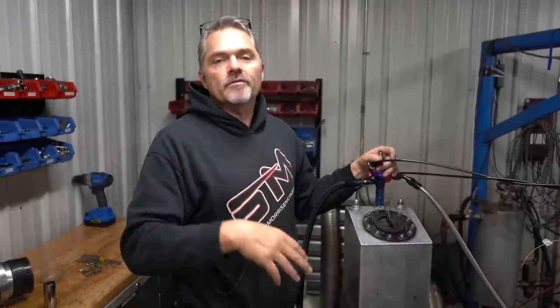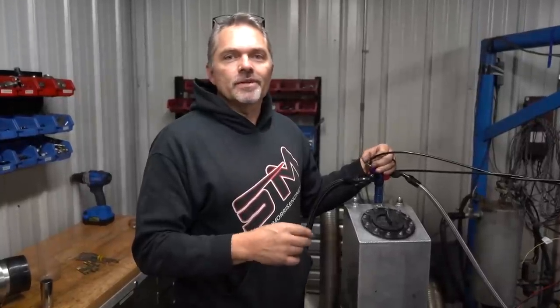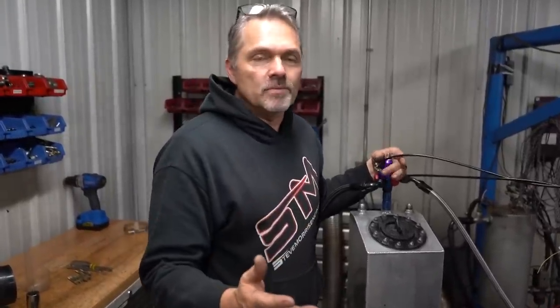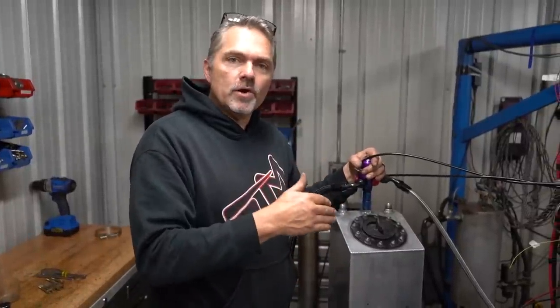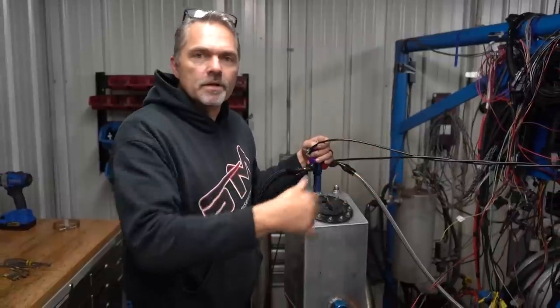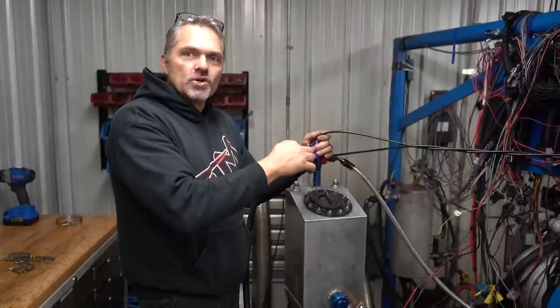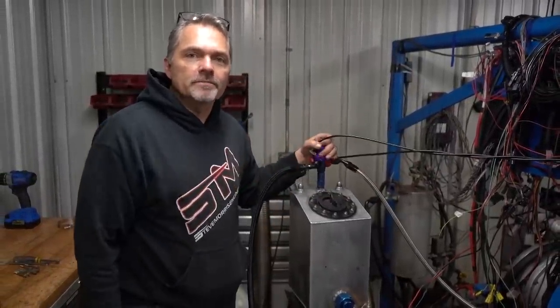I've done all this stuff for the last 20 years and you just kind of forget telling people about this stuff because people go to EFI right away. But if you're a blow through carburetor guy, you have a great big fuel pump because you want to make a bunch of horsepower, 12, 1300 horsepower, whatever. Make sure your return line is bigger than your feed line. Tech tip for the day.